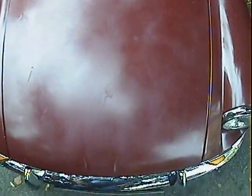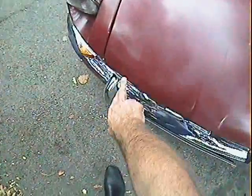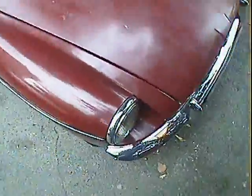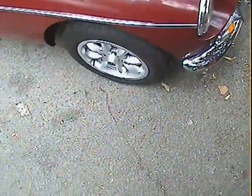It probably could do with repainting to make it as nice as the rest of the car. The bonnet, wing tops, scuttle, and roof could do with repainting just to make them as nice as the rest. There's a little bit of electrolytic reaction just there on the edge of the bonnet, but no bubbling around the headlight cowlings at all, or all around the front arches.